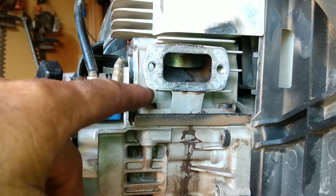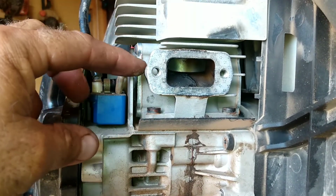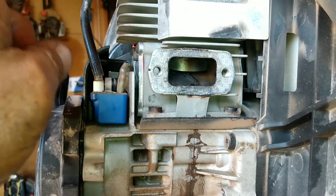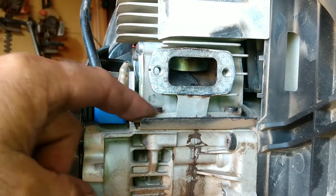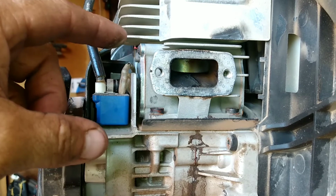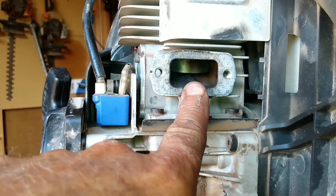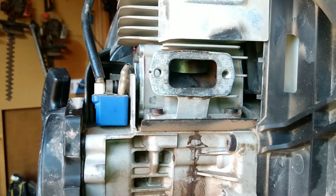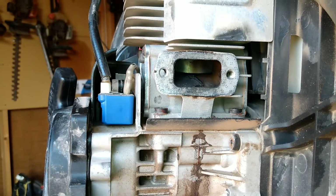They put a little bit of Loctite on them, but generally they come out okay with an impact. If you can slide that jug off of there, and then just replace the piston and get the new jug and the new piston and all that stuff and RTV this down here. This thing is totally worth saving. We know it's getting gas. We know that the ignition is good. That's our problem right there. So if you had to put $100 into this thing, for me, it's totally worth it. Because I would turn around and sell this thing for an easy $300. Make $200 off my $100 investment.